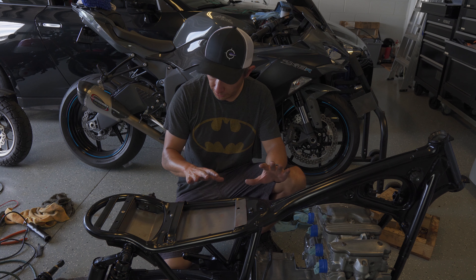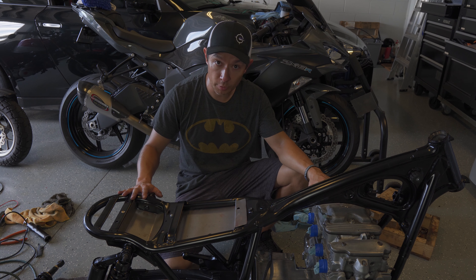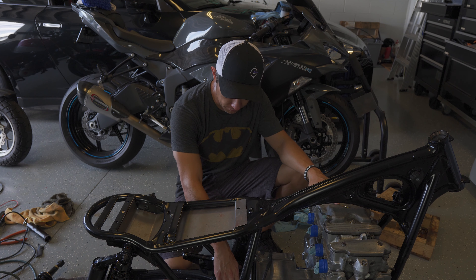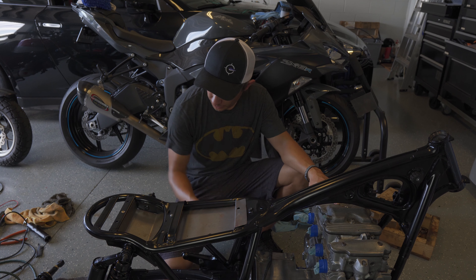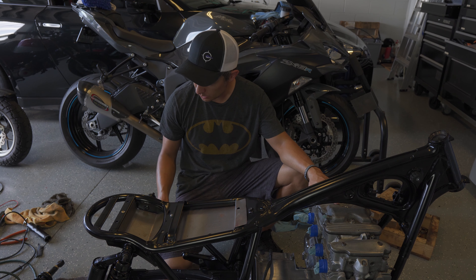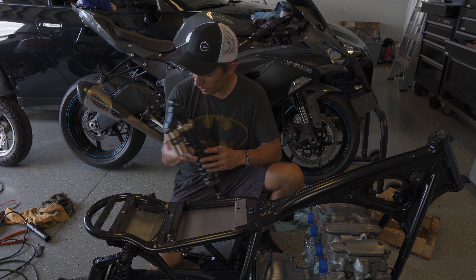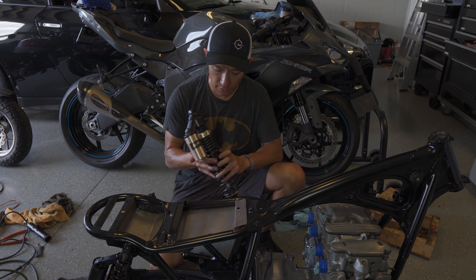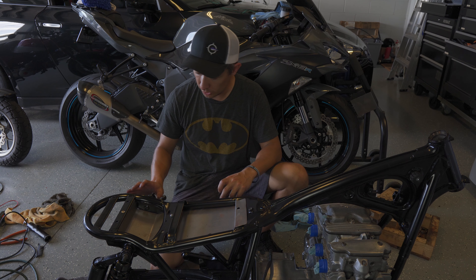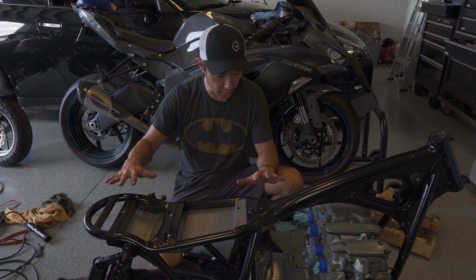It's really hot in the garage, but I've gotten done the things I aimed to do. I've got the motor back onto the frame — there are still a couple of brackets to assemble, but for the most part that's back together. I've got the swingarm reattached with the grease fitting on and grease packed into the main bushing area. I've got the new suspension on. It's not particularly fancy suspension, but it's the right length — the suspension that was previously on the bike was much too long. It's also the correct style, because this bike requires a clevis on the bottom end, and the original had an eye bolt on each end, which was actually offset — a pretty bad setup. I like the all-black look, and they are adjustable, so we'll figure that out once we start riding.